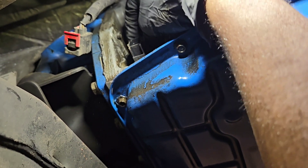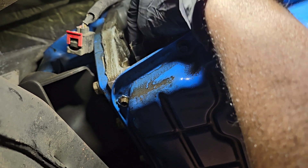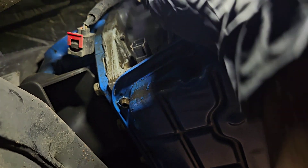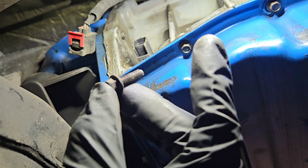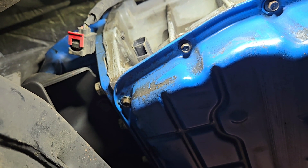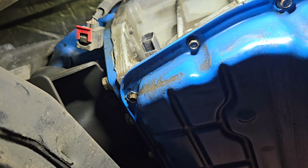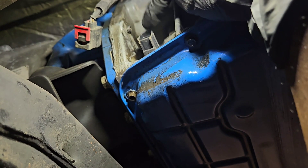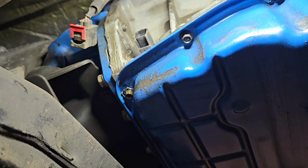I'll get it out with my finger. Hopefully there's not a lot of oil behind this — that's the bolt right there. I'll move out of the way just in case a lot of oil comes out. It looks like a press fit, so I'll just wiggle it out and put the new one in.